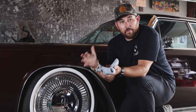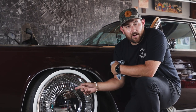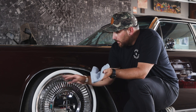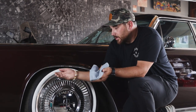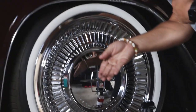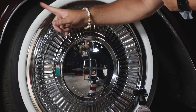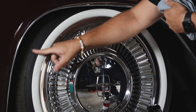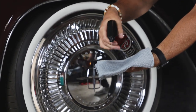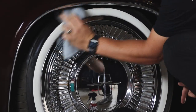One of the last things to do the day before is clean the tires. I'm not going to worry about the wheels now since I'll waterless wash the whole car including the wheels at the show. But I do want to strip off any old tire dressing. As you can see when I rub the tires, it's really inconsistent and black is coming off onto my fingers. I do not want to put fresh tire dressing on top of that — I want to apply it to naked rubber. So I'll take tire and rubber cleaner, spray it onto an edgeless utility towel, and scrub the tires.